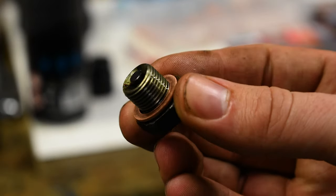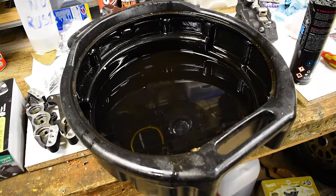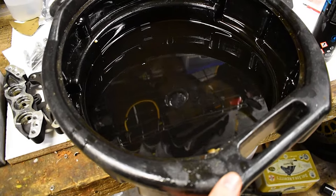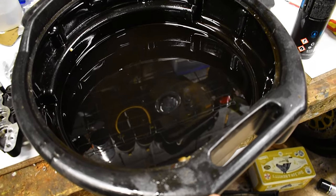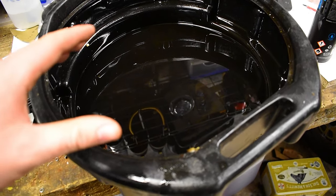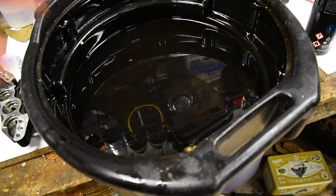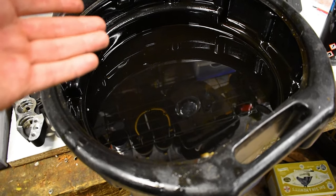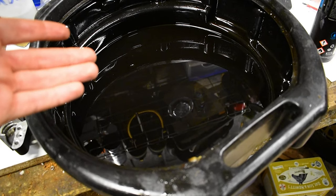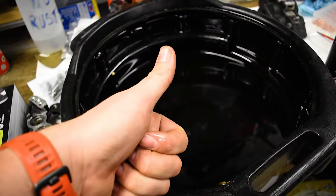Now it is going on the bike — look at the little bolt celebrating with its lovely new copper washer! In all seriousness, that oil is not as bad as I thought it would be. It's pretty murky and thick — definitely did not want to stay on the bike any longer. That's why I wanted to get the bike running first — to heat it up to get the oil out. Because if I hadn't cycled the engine, this stuff could have been sitting absolutely anywhere. No metal came out on the sump plug, and it is a magnetic sump plug, thankfully. So this actually looks okay.